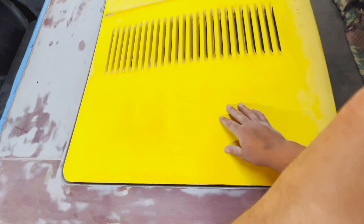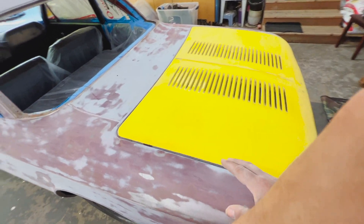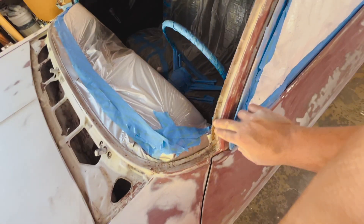I've gone over the entire car once sanding. A lot of it I hand sanded by mistake - I don't know why I was hand sanding. When I got to the hood back here, it was painted once and had this little gloss to it, so that was taking forever to hand sand. I grabbed my actual sander and started going at it. I'm tired of sanding - I want to play with the sandblasting gun. I'm going to pull the car out, fire up the compressor, hook up the gun, and start blasting either the front or the rear window seal area to see how it works.